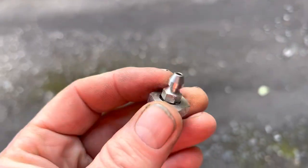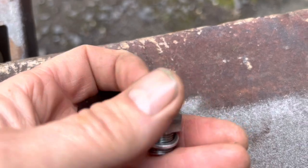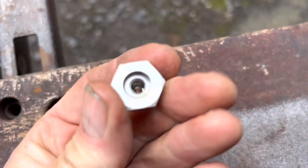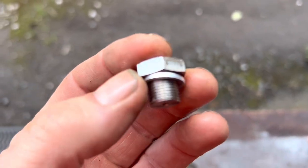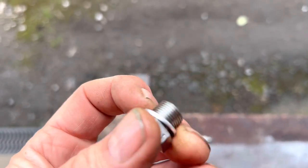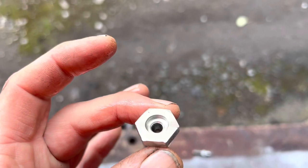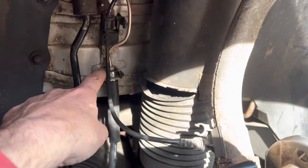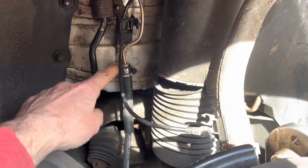So we're going for plan F. This is a special fitting — an M12 x 1mm thread insert that screws into the hole we've drilled and has its own seat inside it, so we don't have to worry about our damaged conical seat. The only problem is we need to glue this in, and the hole isn't quite deep enough to encompass all the threads. Even though it comes with an aluminium crush washer, it's not sealing — we'll have to dry that out and drill slightly deeper.